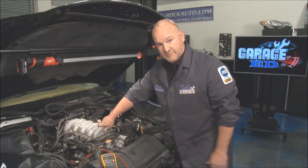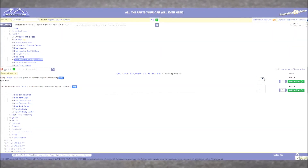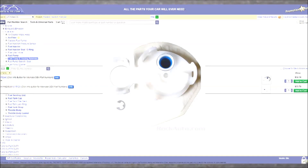For more tech tips, Tom and John have some great information. We just took a good look at a fuel injector — that's kind of the heart of the system on the outputs, but it's part of a system. You need to look upstream and downstream to see if other parts are equally likely to be worn out or contributing to why that part failed. Something that's changed in the last decade is cars don't have separate fuel filters very often anymore — they'll just have a fuel strainer attached to the fuel pump assembly in the fuel tank, sometimes more than one if the fuel tank is U-shaped. If that strainer's clogged up, it prevents flow of fuel to the fuel injector and can contribute to the death of the fuel injector.